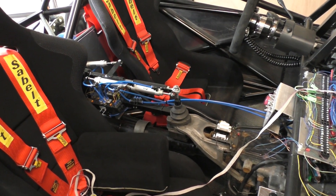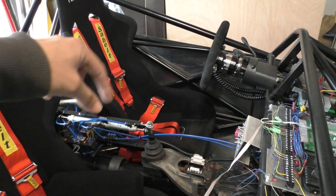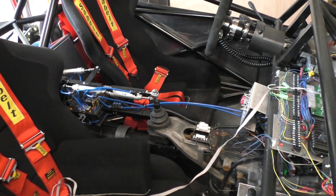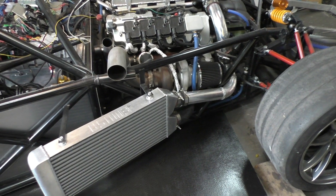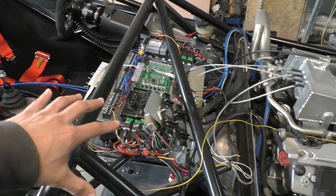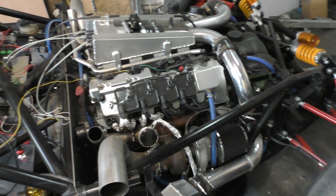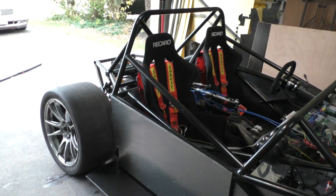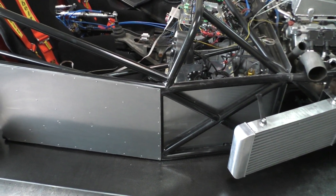What I'm thinking of doing is mounting potentiometers on both axes of the gear lever movement - so it can sense position when moving side to side and also when moving forwards and backwards - giving the circuit full feedback to control the gear shifts way better. Right now I've put the whole transmission shifting thing on hold because there are a lot more things I need to do before I can get this car on the track - making the front splitter, a cover for all the electronics, mounting gauges. I really want to take this car on a dyno this week, get everything tuned and alignment done, and actually get the car on the track before winter temperatures arrive.